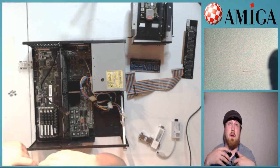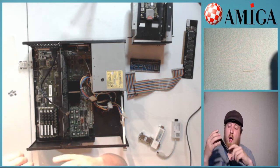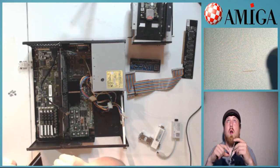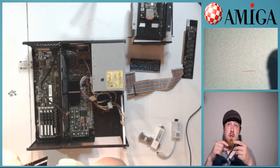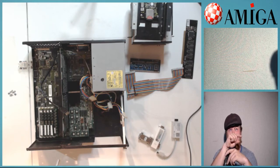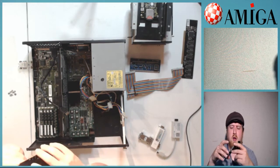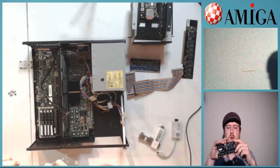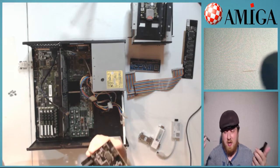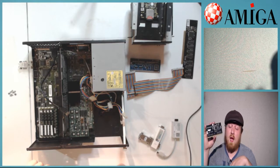And there are even some productivity modes that Luke recently released with the newest firmware and drivers that are not necessarily 4x3 or 16x9. They're more like perfect ratio screen modes, like 1024 by 1024 or something like that, equal perfect screen modes for productivity things at 15-bit, even 16-bit. So it's a very capable graphics card that's still being developed.